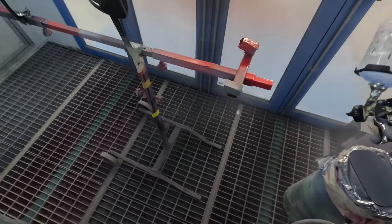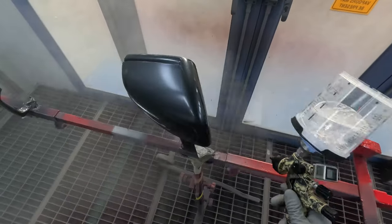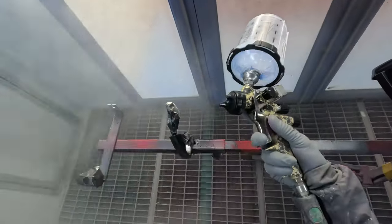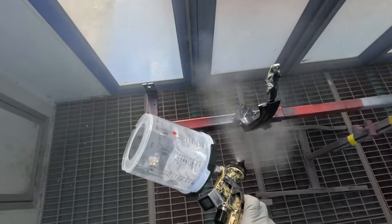You manipulate it by the way you spray. A little bit heavier on your first coat and you're going to get European finishes. Crank that pressure up on the first coat, put it on ultra skinny, and you're going to get the flattest finishes you've ever seen.